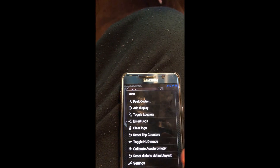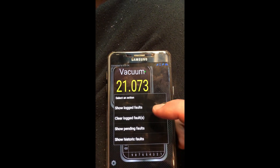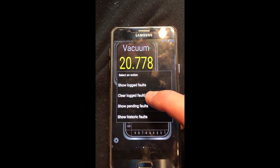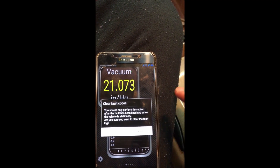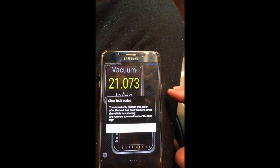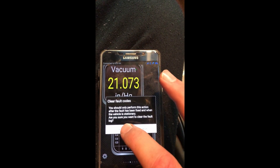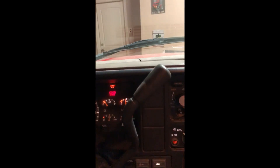What we're going to do is go back to the fault codes again. You can see it says show pending, show historic. We're going to hit clear logged faults right here. If you look up, we've still got the engine light on. So we go ahead and hit clear logged faults. It tells you that you should only do it if the fault's been fixed - but if you just want to see if that's what it is, clear it out. If it comes back on, scan it again; same thing comes up, you know that's it. We say okay - and right there, you see how quick that was? That light went right off.